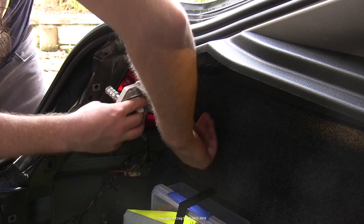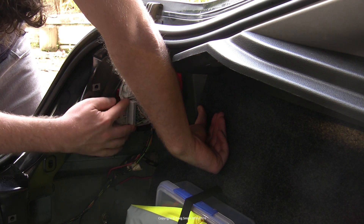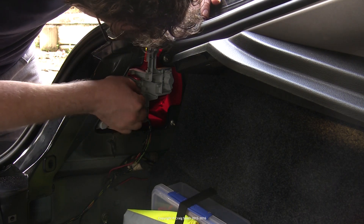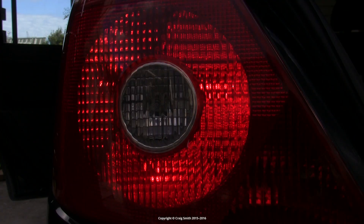As for that brake LED, I will replace it in a future video and show you what I use, but it is more difficult to find an LED type that's suitable because you need to find one that is both dim enough when it's on the tail light mode and bright enough when it's on the brake light mode. In the meantime, this is replacing fully two-thirds of the tail light bulbs, and therefore we are getting most of the power saving benefit and the performance benefit just from doing these two bulbs.